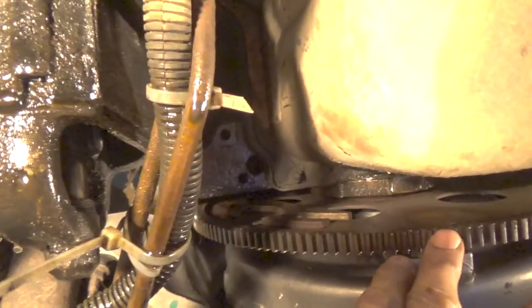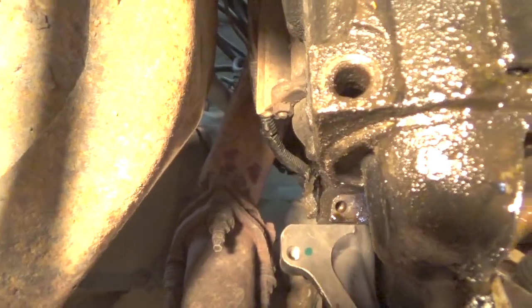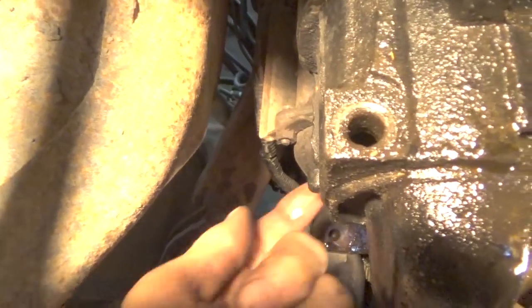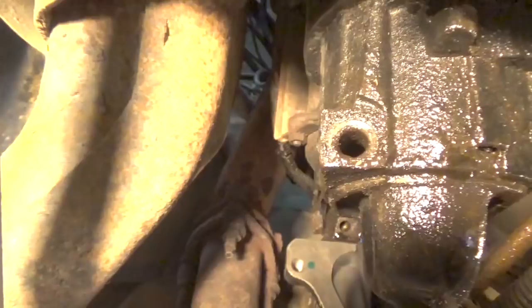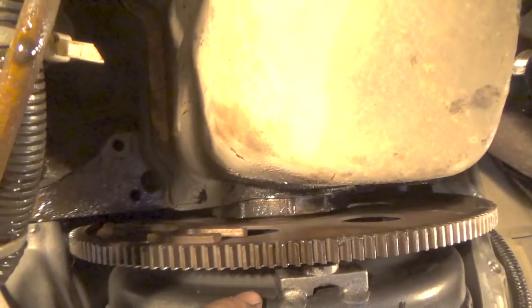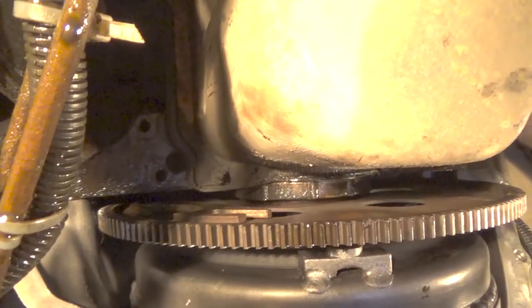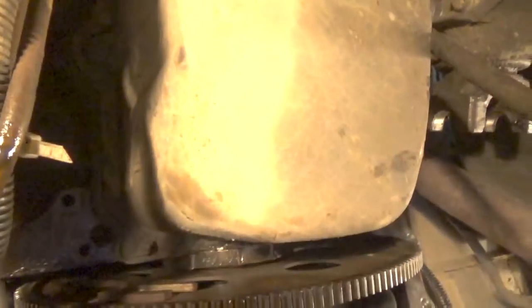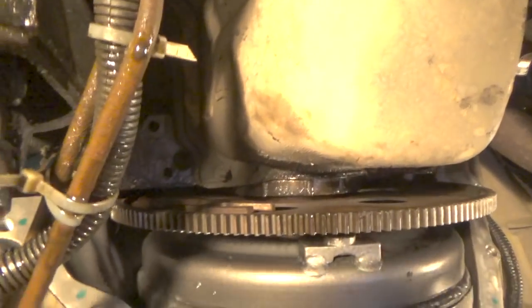Okay, now what we want to do before we tighten the torque converter to the flywheel, we want to put 2 bolts from the transmission into the bell housing of the engine, or into the engine. The bell housing is actually on the transmission, so we want to put bolts somewhere near here in the back to come through into the block of the engine on both sides, at least 1 bolt, just to keep it from moving back, because if the transmission should slide back after you start tightening the torque converter to the flywheel, you're going to have to play games trying to get the shaft back onto the torque converter. So you really don't want to have to play that game, because it's kind of tough on some cars. I know on some Dodges it's like turning tumblers trying to get them back in on a safe, but Chevys aren't that bad for that. So we're going to put 2 bolts in there.